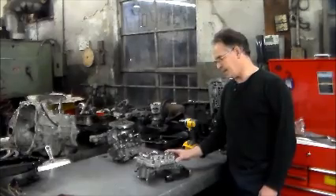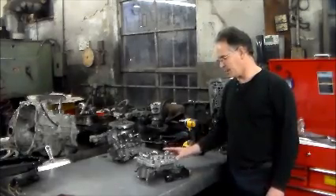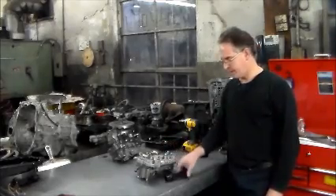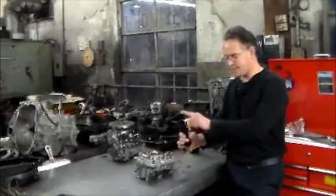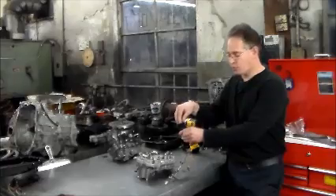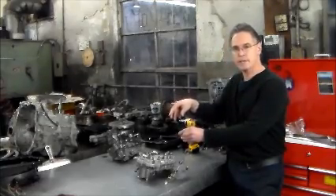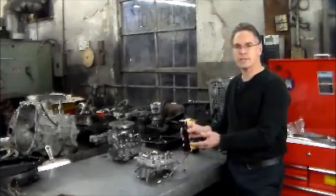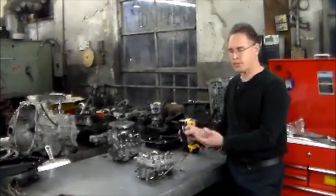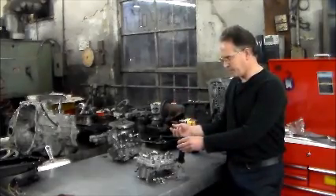Pretty much what I did — the thing is, with this 2010 model year, the computer — this is the harness — this is what sticks up through the case. The transmission control module bolts right here and bolts to the case. So there's really no wires anything that you can tap into to check this. So what I did was I popped the computer out and I ohmed the solenoid.